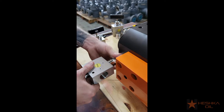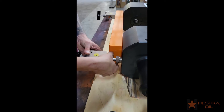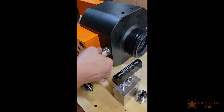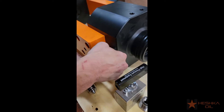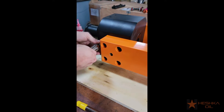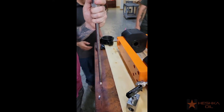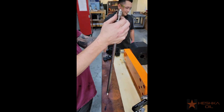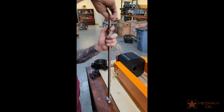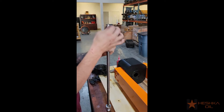We then install two of the two-way needle valves onto the glands. This will make this side of the lubricator the bleed side. Next, we install the four inch high pressure tubing on the opposite side of the lubricator. With the last glands and collars in place, you can now install the glands and collars onto the 20 inch high pressure tubing using the same method as before. With your tubing ready, you can now install the last two needle valves.